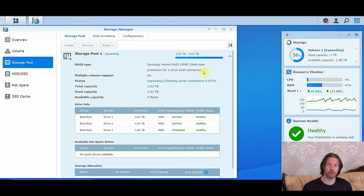This is better for redundancy and fault tolerance, but it isn't a backup. Don't consider an array as a backup — because if you get hit by the cryptolocker virus and your documents get encrypted, that's going to go across all your drives. This is only purely for a single drive failure. Also if there's a hazard in the property such as a fire or flood, if that drive or the server is destroyed, it's not a backup — you've lost it all. A lot of people make that mistake thinking that a RAID is a backup. It's not. It's better than nothing and they're very good to have, but do have a backup system in place. With our server we've actually got a separate server both on-site and off-site to do that, so if something was to happen, we've got multiple forms of redundancy.